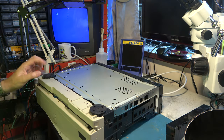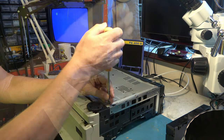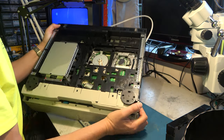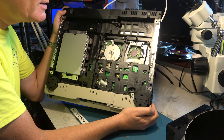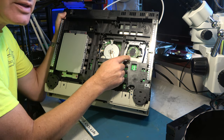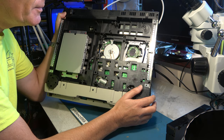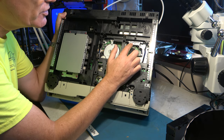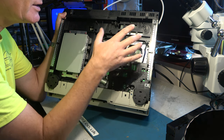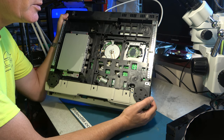Big dent there — might have been in transport arriving with me. There's certainly a little bit of straightening out needed. These head drums — I've mentioned this before — this whole PCB is prone to developing dry joints, probably due to vibration. Some of the dry joints that can occur will appear under this bracket, so it may be necessary to take the whole head drum off to get good access. But first I'm going to have a look at that with a microscope.